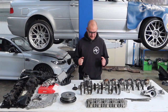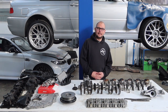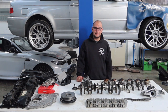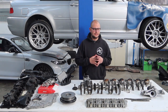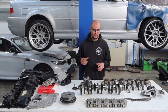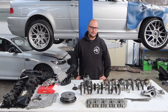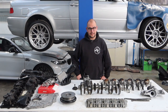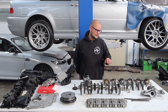Matt just finished stripping the engine down. We obviously knew a fair bit about these before stripping it down, but it's quite nice to see all the little details that a lot of other videos don't mention, and to take it apart to a level that many places don't. It's an unfortunate thing with many modern engines that companies will just drop in a rod and piston combo, which isn't really the right way of doing things. If you're going to blueprint an engine, you want to have it right apart and measure everything, including main bearings. Some of the standout features — it's quite nice to see main caps back.